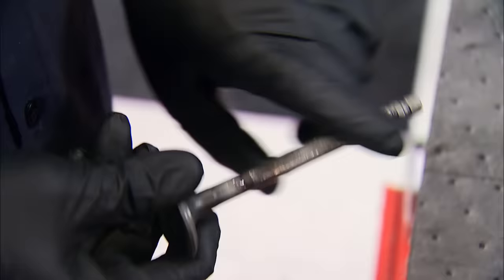During the break we got the engine off the table. Wrapping up the bottom end is just a few short steps away, then we can get it on the dyno cart or drop it into the engine bay. To supply oil, a Melling high-volume oil pump from Summit Racing, held in place with ARP bolts. The pump's pickup bolts up now. Felpro offers oil pan installation studs that guide the gasket and pan to the block, hold it in place so you can start the fasteners, and keep you safe since you don't have to look under the engine to align it.